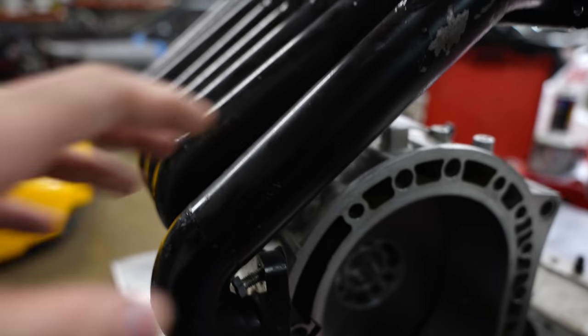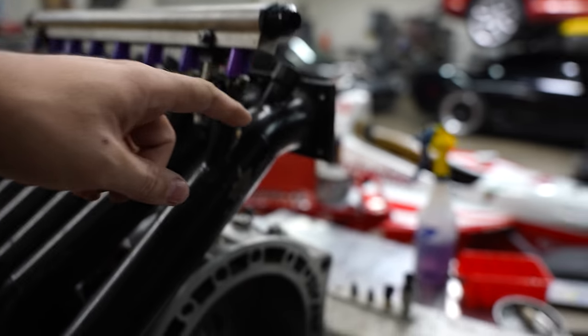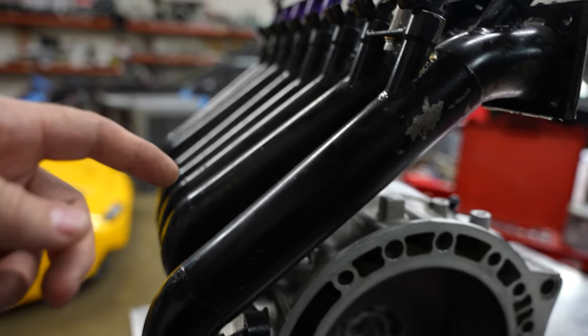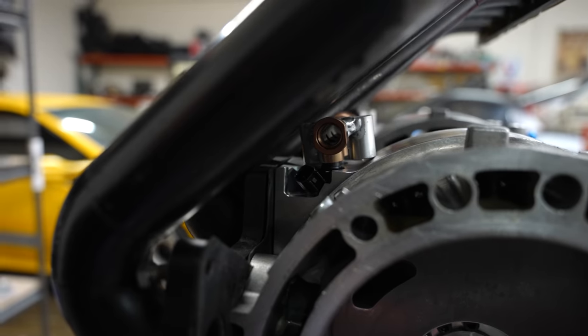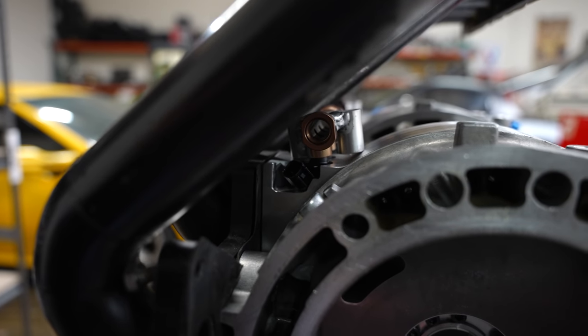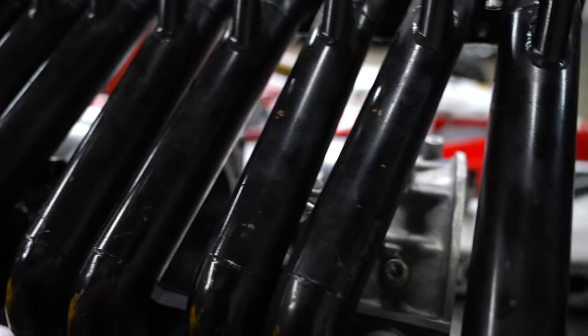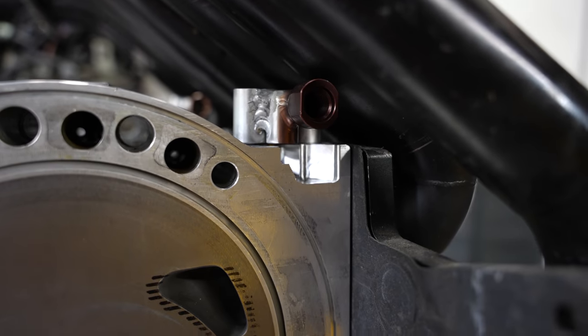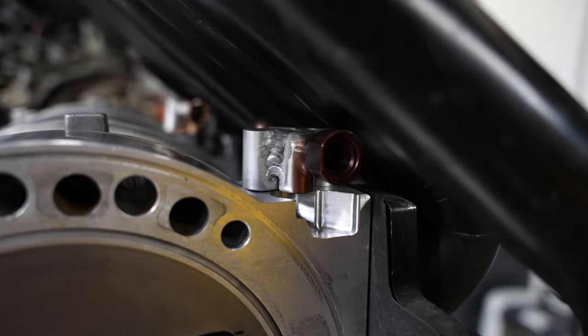So you can see this is the intake manifold for the all-wheel-drive four-rotor. It's missing the big tank because that is just too hot to handle. There are the injectors that I've now inserted into the primary rail. They're not cut all the way down — you can see right there — but they hit this runner as I was expecting. All the measurements led up to doing something really impressive. This one, not so much. This one's not as bad. You can see that they're not fully touching the manifold, but at least when I go to cut that down it'll fit quite nicely.